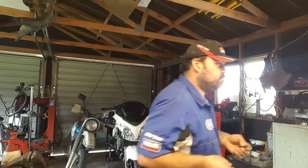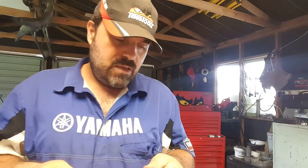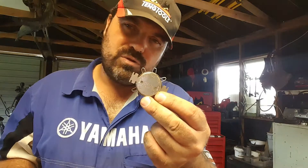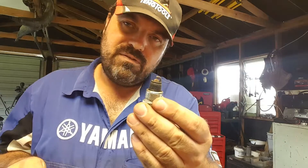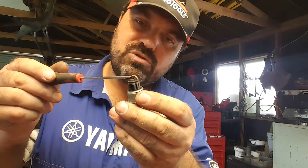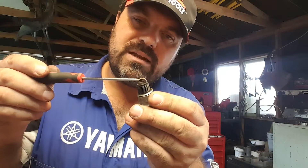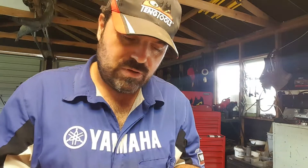If you haven't got one of these tools, then you can use a little tiny flat screwdriver. My videos are all about trying to use a basic set of tools to get all the jobs done. You might have the special tool in your workshop but probably wouldn't carry it in your toolkit in your car. If you're fixing somebody's vehicle on a Sunday and you've gone to their house, you could probably find a flat screwdriver. So to adjust it, just put the screwdriver in the gap and then very gently ease it up to increase the gap — it's very tiny amounts, we're not talking very much.